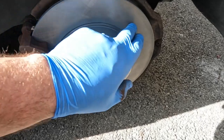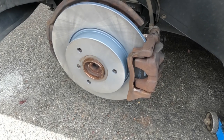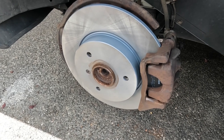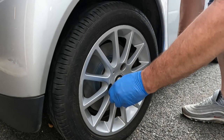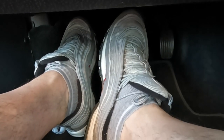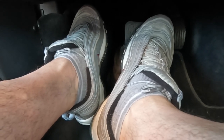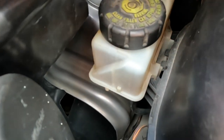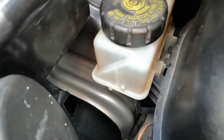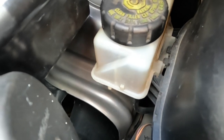All done. I just like to check the brake disc for any little bits of grease or muck and spot clean them, then the wheel goes back on. The other side was successfully done with no problems found — everything went pretty much the same as the offside front. Now it's really important that you pump the brake pedal a few times after this job before you attempt to go anywhere, as the pedal will go straight to the floor for the first few brake applications — you'll be in for quite a shock if you don't. Check the brake fluid; if pads were very worn and you had to push the piston in far it can raise the fluid level so you may need to drain a little off. Go easy on the brakes for the first 50 to 100 miles as they'll take a while to reach normal performance levels.